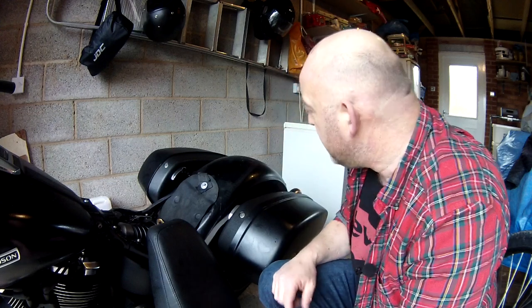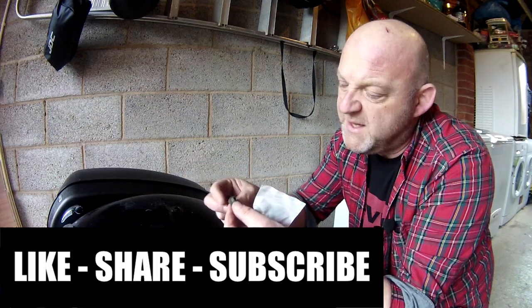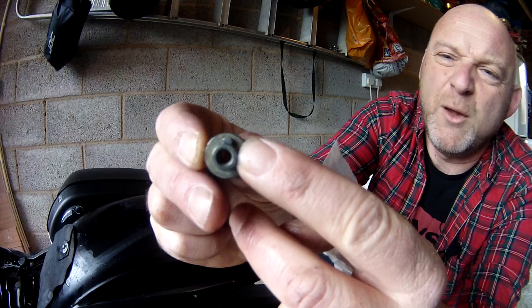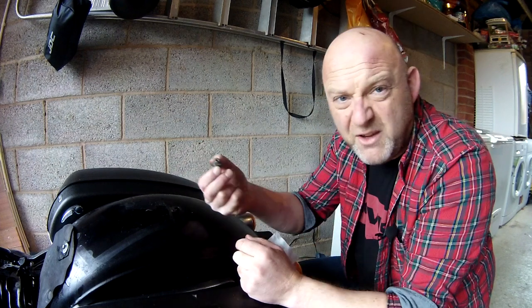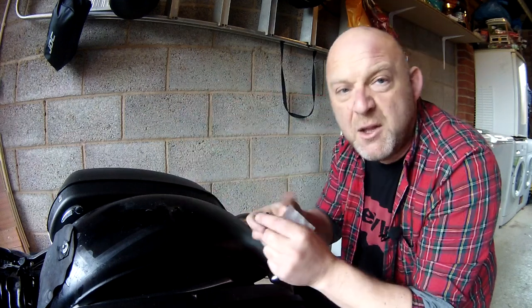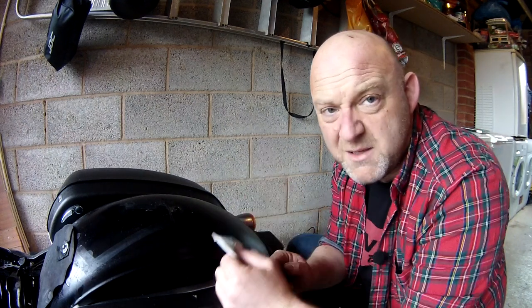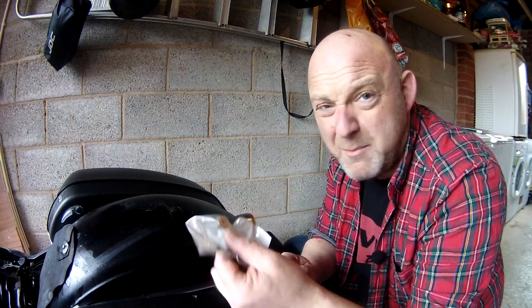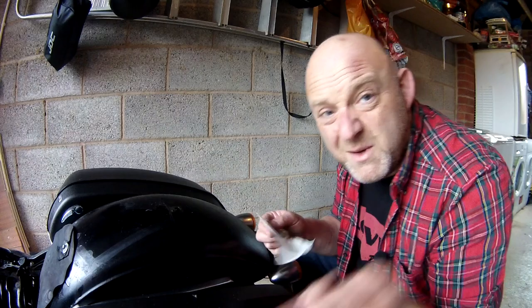So all I need to do now is put the seat back on. What you also need to do is make sure the rear seat retaining nut is in with the clip. Beneath the fender you have this retaining nut and it only goes in one way — there's a little cut-out, a little notch, and there's a notch in the fender that slots in there. On top of the fender there's a little plastic horseshoe that goes over the top to stop it dropping out, and then you just screw in your seat retaining nut. The problem is that little plastic horseshoe breaks really easily — it is not very good and not very strong. You can pick this up from your parts department and it's not Harley prices — it's only a couple of pounds, you know, three dollars or something.